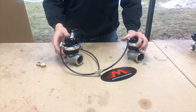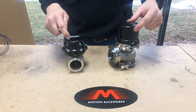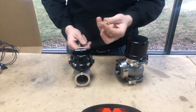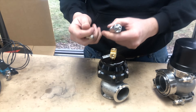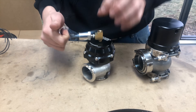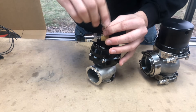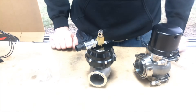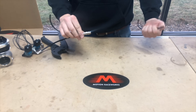Since the Precision and JGS only have one top port, you could drill and tap another hole — anywhere on the dome is typically fine, just inspect the bottom for spring pockets. An easy solution is to use one of these brass T fittings. I always use this style of brass T — it's strong; Sebastian from AMS 2000 showed me this years ago. The last thing you want is a cheap aluminum or steel one, because the weight can bounce and break the T off right before an elimination round, which is why we include the brass T in our CO2 kit.